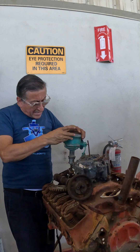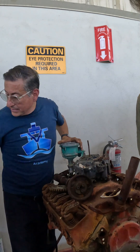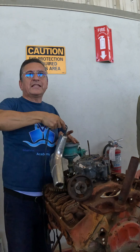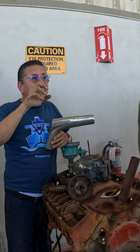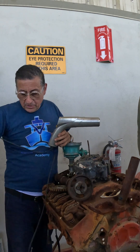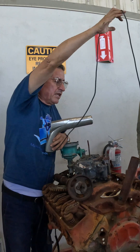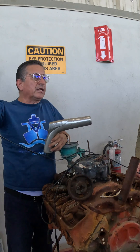What is the recommendation? I set it at zero. I prepare the timing light — the timing light is a strobing light, a stroboscopic light that matches the frequency. You connect this one to the cable of cylinder number one, and this one to the positive and the negative of the battery.